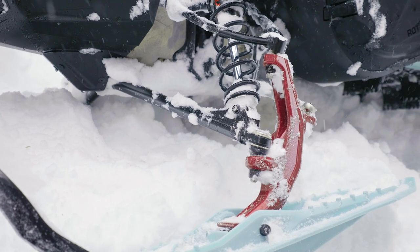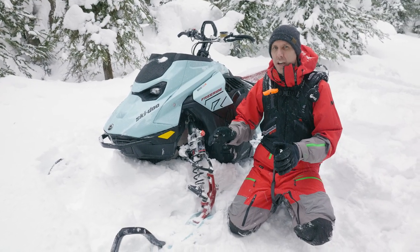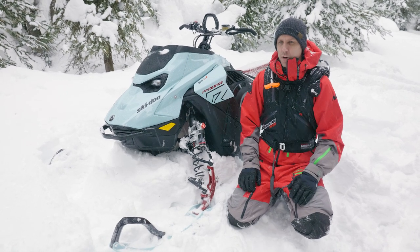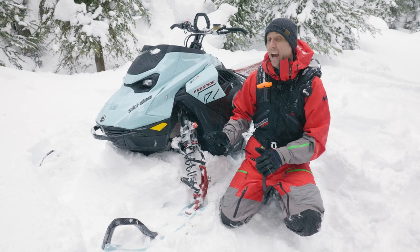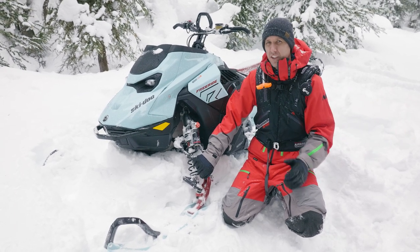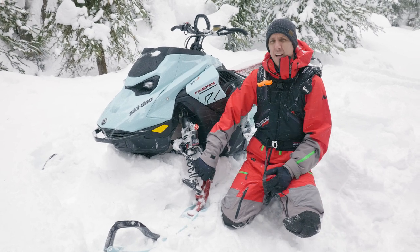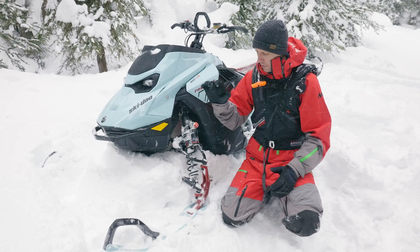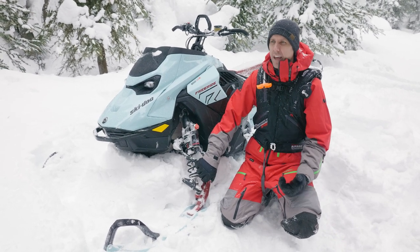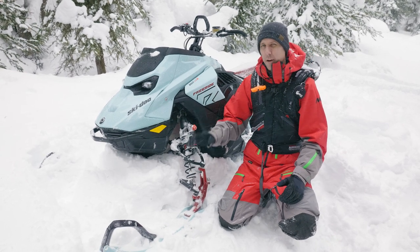The spindle has been revised to give a little bit more stability, and that's the general idea for this sled — Ski-Doo wants to build something with a little bit more stability for its athletes and the really hard-charging riders, the guys that are doing big hits and really gnarly approaches into jumps where you want more stability and control. Part of that is the 36-inch ski stance. The rest of the Summit lineup, with the exception of the base model Adrenaline, has gone to a 34-inch ski stance, which makes it a lot easier to tip up and hold on a side-hill edge as you're making your way through the trees. But for the Freeride — big landings, big hits, hard approaches — the riders said they want that extra stability from the 36-inch ski stance. And in fact, when you're riding it you can feel that it is a little bit harder to tip up than the Summit sleds, which was very intentional.